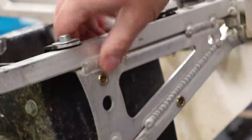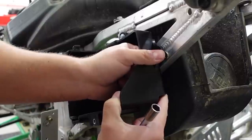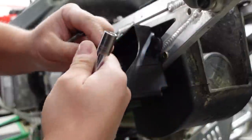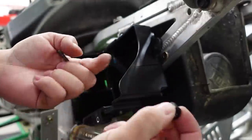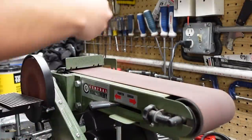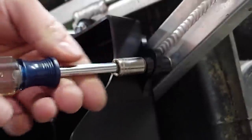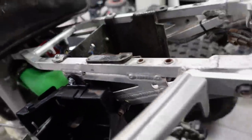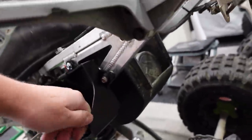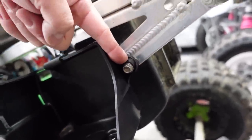Now we can actually mount our battery box up. On the back one, you can see this tab is on a slant for the Honda. You could probably just blast a screw in there and it would work, especially with Loctite. But I want it to look a little bit cleaner, so I have these plastic bushings that I've sanded on an angle — you could do that on a bench vise or with a piece of sandpaper. I just put an angled one on the top and the bottom, and that'll make the bolt go in nice and straight. I don't like the way those spacers kind of slid to the side, so because this is only held on by two bolts, I'm going to upgrade from an M6 to an M8. I'll drill the nut cert out and put a larger one in, and it'll also be the same size as the inner diameter of the spacers, keeping them aligned.